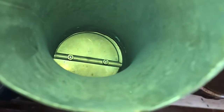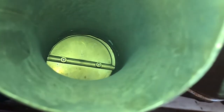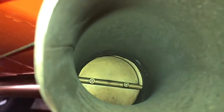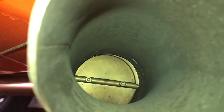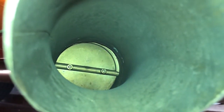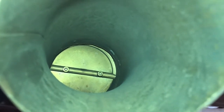It works pretty well with engine vacuum. I got the ones that are always closed valves — you can also buy the ones that are always open. The problem I've been having is that once I connect the vacuum, they open, but at wide open throttle they close because vacuum obviously drops in the engine, so it's not enough to keep the flappers open.